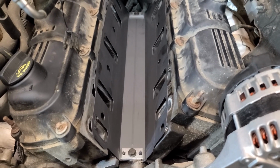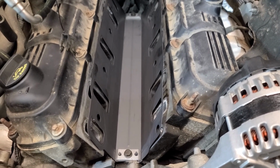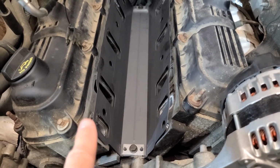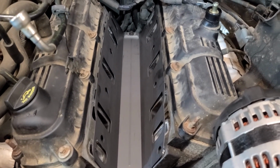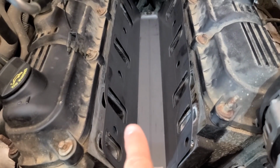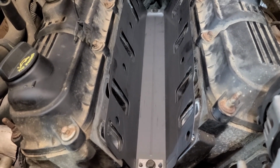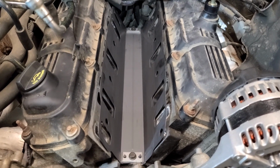One thing I did do that I didn't show in the video was clean up the upper manifold. I vacuumed it out earlier before I took it off, but I just gave it an extra rinse and also cleaned up the same surfaces that mate to the gasket here, just like we did on the surfaces of the cylinder heads right there. So same idea, scraper, brake cleaner. I would suggest not using a paper towel, especially if you're using brake cleaner. It just disintegrates the paper towel, and you don't want any of that stuff getting in here because these are the intakes. So anything that goes in here goes into your cylinder. You know, minor stuff, no big deal, but you definitely don't want big chunks of paper inside of there. So I would recommend some kind of cotton cloth, preferably one that doesn't shed a lot.